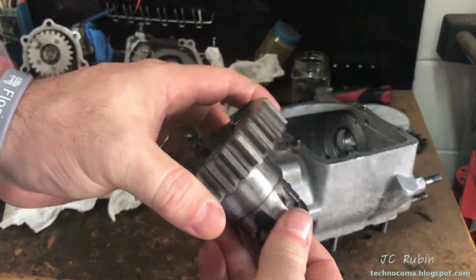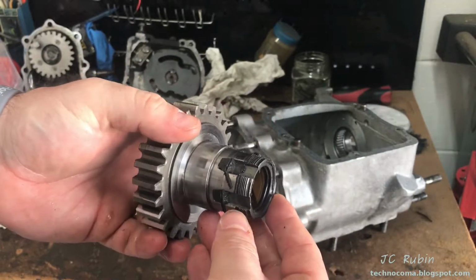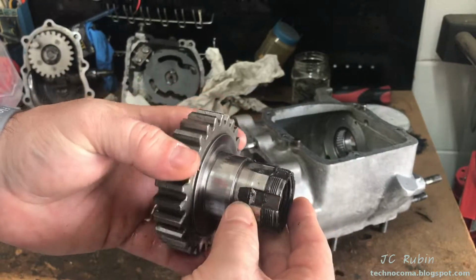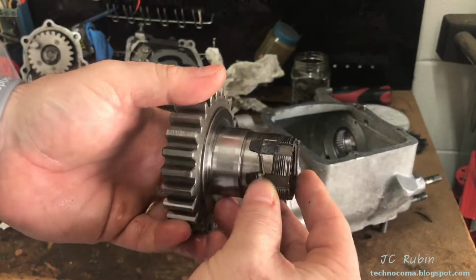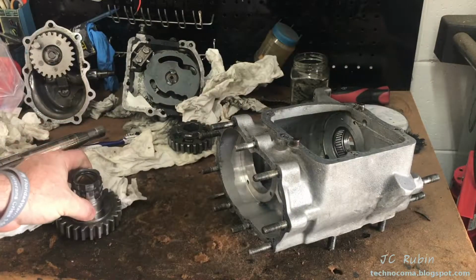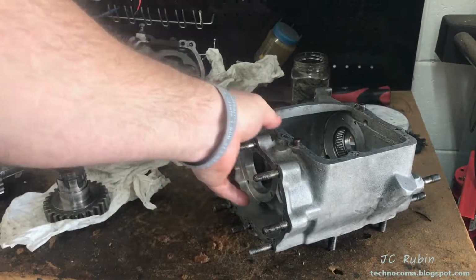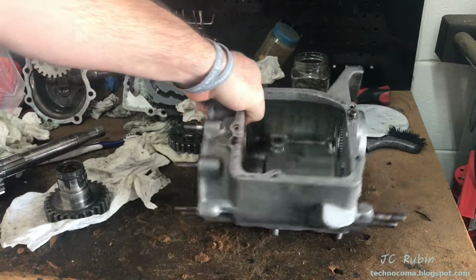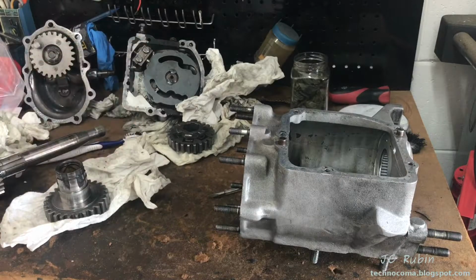I'm going to be sending out my fourth gear for some custom work that's going to make this a leak-free transmission, I hope, of course. We have somebody in the community who does some special work on these gears and get a new gear from Andrews and have it specially machined in Canada for that application. So while these events are ongoing, things are being mailed out, taking these pieces down adjacent to press stuff out, have new seals and bushings and what have you pressed in. We're going to be doing all different sorts of things as we bring this transmission back together.